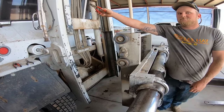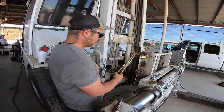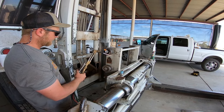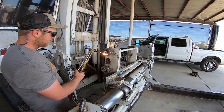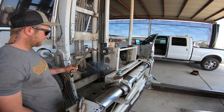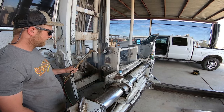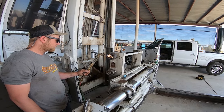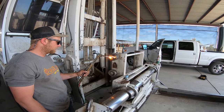You get it really hot and then dump a cup of cold water on it. When you get it hot it expands, and as soon as you put that cold water on it, it shrinks — and what that does is crack the rust that's built up in there. That's the plan. We've done it before, but whether it's going to work in this scenario, we'll see.